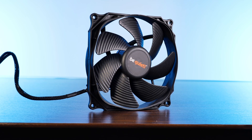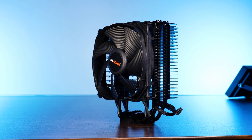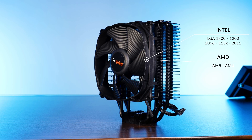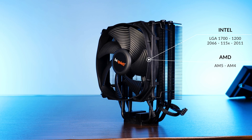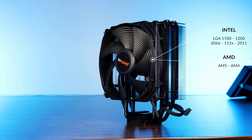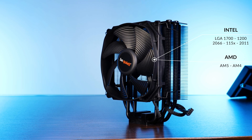If we add like 5% to that, we should be where this fan is at. As for the compatibility, we've got coverage for pretty much everything: LGA 1700, 1200, 2066, 2011-3 and every 1150 on Team Blue. On the red team, we've got AM4, as that's pretty much the only thing that is still relevant. Do keep in mind that AM5 is said to be backwards compatible, so we should also be good there.